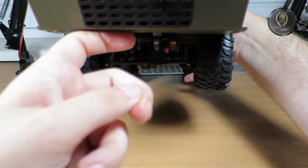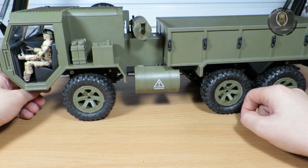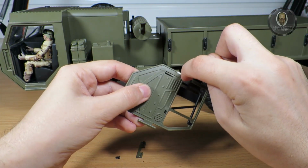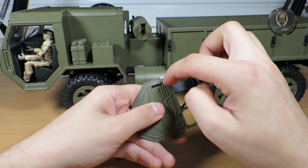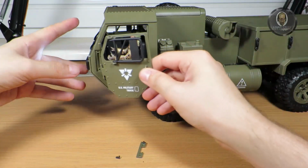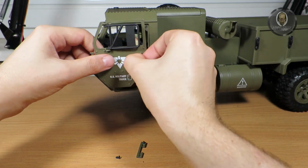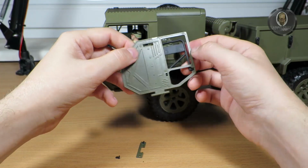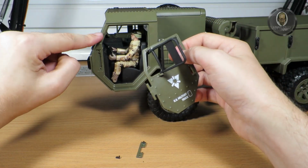And now I will need to just recenter the wheels. I see, need to trim it a little bit to the left. Yes, like this. Of course, I will need to test it outside. The last part that I will not show on the camera is the doors. I will get a piece of metal, grind it to be flat probably, and put it in here angled like this, so that when I shut the doors, it will be wedged like this on the part inside. When I pull it out, the metal part will spring a little bit, and when open, spring back, and that should work. I will probably use a resin glue that will hold it, and this should fix the problem. Then this car will be ready.